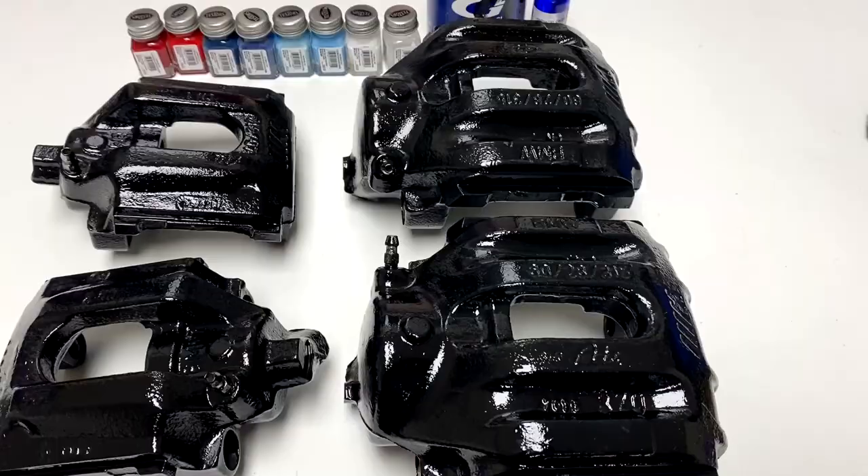Three coats of G2 black — it's a high-gloss finish that works really well on a textured caliper like the E36 M3, coating pretty well and drying hard. About 16 hours later, you can see that pressing my fingernail in, it's pretty hard and doesn't want to come off — a nice hard shell. For smooth cast rotors, you can see brush marks on the machined areas, sort of like old-school oil paint. Ideally you would want to spray it on a smooth caliper, but for textured stock ones it's perfect.